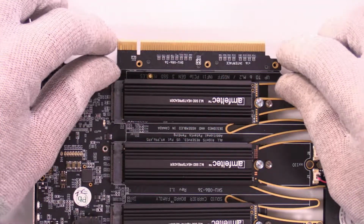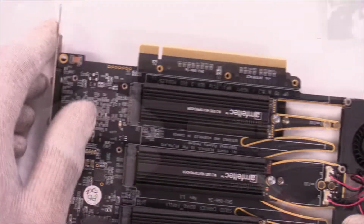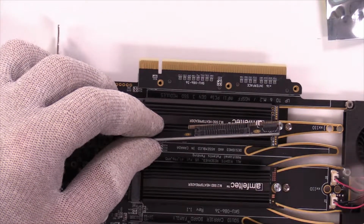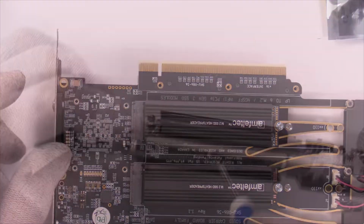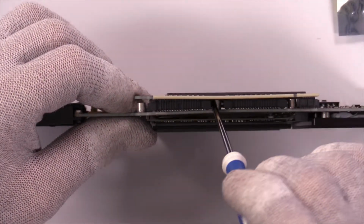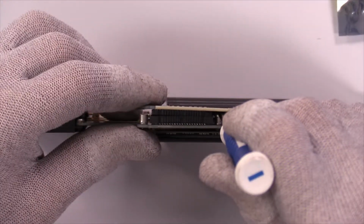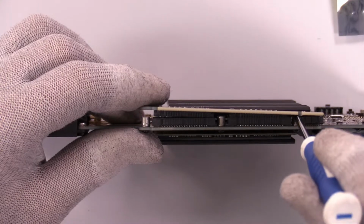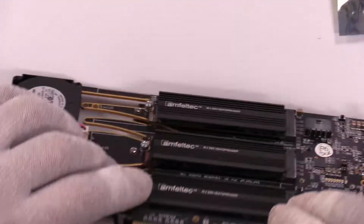Okay, screws are off. That adapter should just pop loose. 3 screws. So I've got to work that loose to plug that in. Gotcha. So we'll use a flat blade. Okay, I'm getting the screwdriver, a flat blade screwdriver, up in between and pushing so I don't damage anything on the board or the circuits. And I'm pushing right at the screw holes to get that loose.